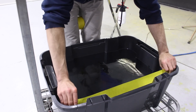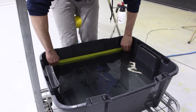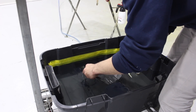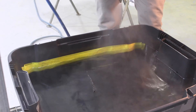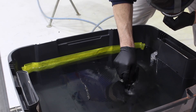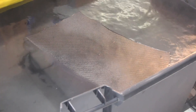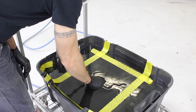A great way to clean the top of your water is to use some masking tape — just drag it along the surface and it should get rid of all the floating rubbish. The hydrographic film comes in many different graphics. This one is a carbon fibre weave and it holds together quite well once sprayed with the activator. Some films actually spread quite far and the image can be distorted. If that's the case, you can put masking tape around the film to stop it from spreading. I've put three layers of tape around the image so that once I spray it, it doesn't spread too far.